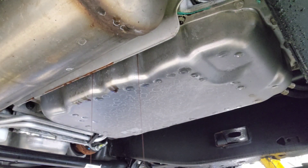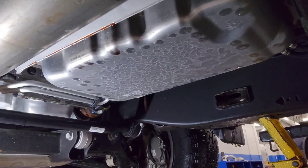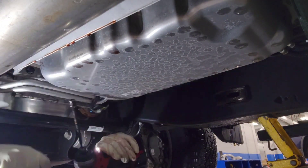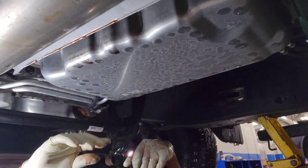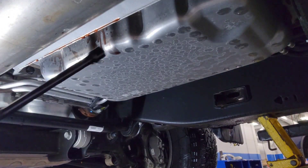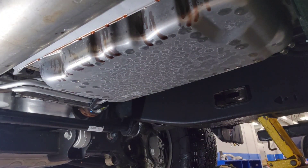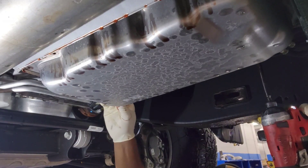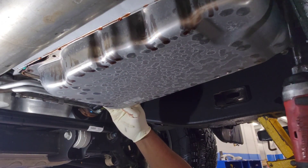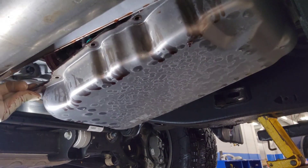Let the professionals handle it, especially if your vehicle is on warranty. This vehicle here is a 2023 Chevy Silverado. It's a common transmission found on a lot of GM vehicles, mostly on higher trim GM trucks and SUVs. This one has a P0747 fault code — a gear issue, stuck solenoid — and GM issued a bulletin for it at the end of last year.